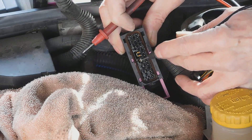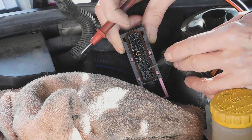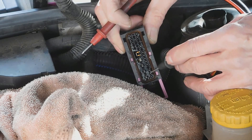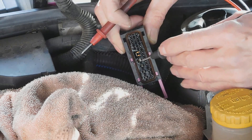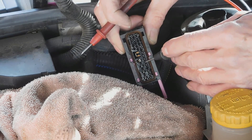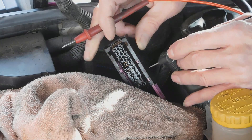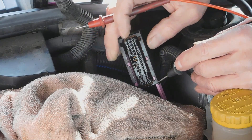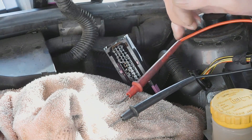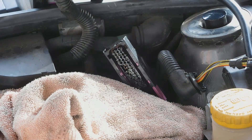There are 4 big pins and the small ones from the bottom where the clip side is — 1, 2, 3, 4. Pins 1 and 2 are right-hand rear. Pins 3 and 5 are right-hand front. Pins 6 and 7 are left-hand front. Pins 8 and 9 are left-hand rear. So yeah, pins 3 and 5 are out of the normal range — it should be minimum 0.5K — so it's almost shorted. I need a right-hand wheel sensor.